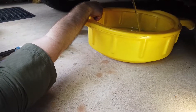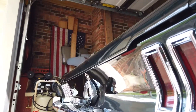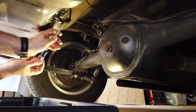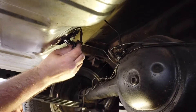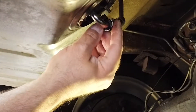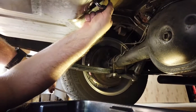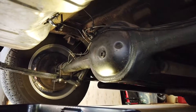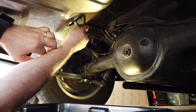Alright, so I disconnected the electric. This is the small flex hose from the fuel sender to the fuel line — that's this piece here. I hope you guys can see this; if you can't, sorry, you don't have a zooming function on this thing. Remember, even though we drained the tank there's still gonna be fuel in the fuel line. That's what you see coming out.